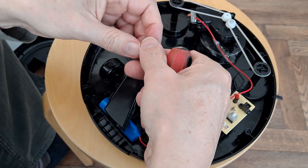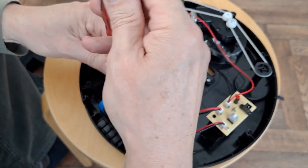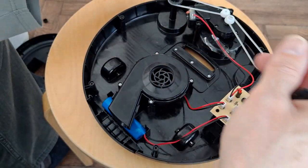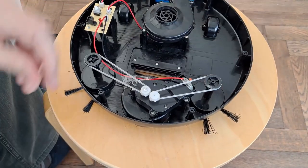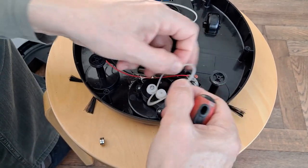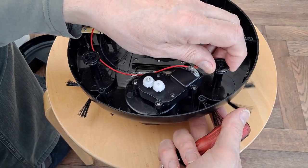If you just turn the screw forwards, you're probably going to cut a new thread in the plastic, which means you'll damage the original thread. If you turn it backwards a little bit, you hear it click, and that's the threads lining up, so you're not cutting a new thread. Okay, let's have a look in here then. I don't think we've got anything clever there. We've just got a pulley on the end of a shaft that turns the brush.